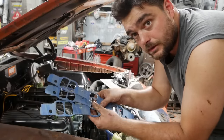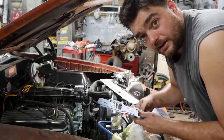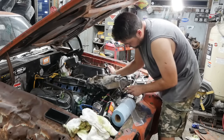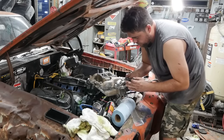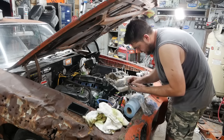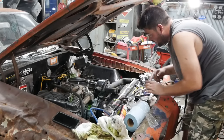I just opened up this Fel-Pro package — one, two, and three gaskets in it, got a spare. On Pontiacs you've got that bolt on the front that pulls the intake forward, and it has a little rubber O-ring. I coat that O-ring on both sides with a little RTV. I'm usually not the guy with the valley pan full of antifreeze, so hopefully it'll clear the valve covers.